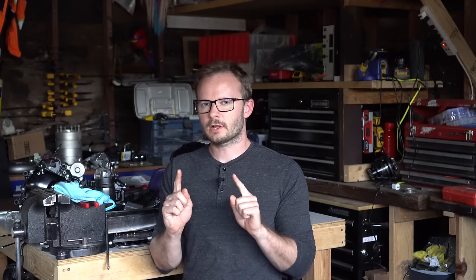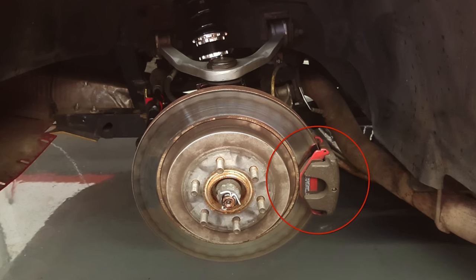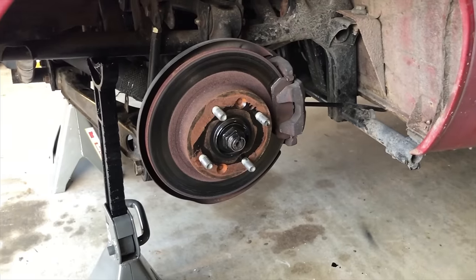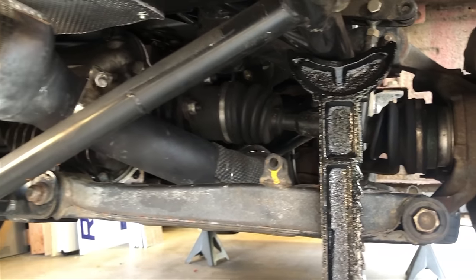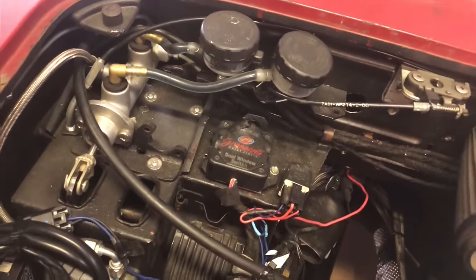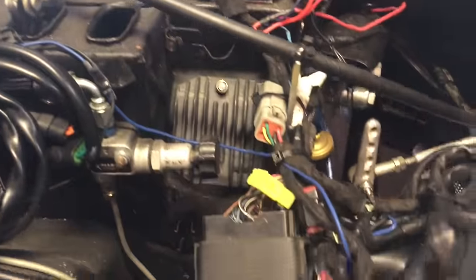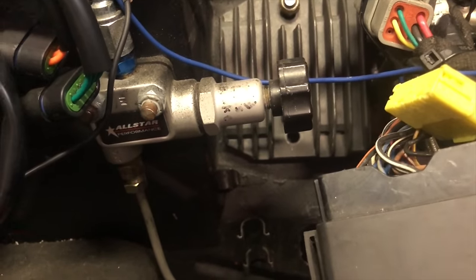We're done with the powertrain, but we need to talk about brakes — the stop train. Brakes are easy to forget; Dodge forgot them on the first and second generation Viper, putting brakes from a Plymouth Laser on a car with a stupidly huge engine. This project used stock Miata brakes, which seem small, but this car weighs 1,300 pounds so they're plenty good — performance brakes for this application. Since I used Miata uprights, mounting the rotors and calipers was trivial. The master cylinder required a custom mount and getting the leverage right. I added an adjustable proportioning valve since the Miata's wouldn't be calibrated for this setup, then ran new brake line through the car. There's no power brakes, but it's fine on a car this light — I'd think about power brakes above about 1,700–1,800 pounds.